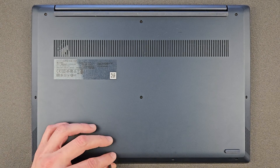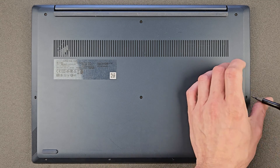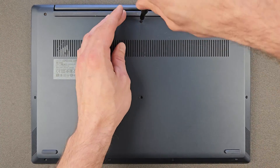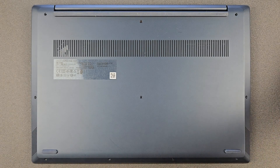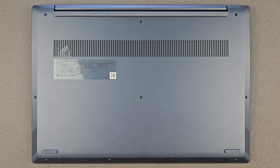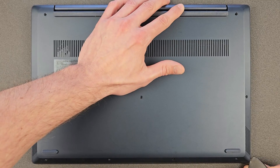I'm just showing you the screws here — they're all the same size, so you don't have to keep them separate from each other. Sometimes they are a different length so you have to remember where you took them out, but not this time. Go ahead and remove all of them and you're ready to lift the back panel. The back panel comes off easy enough. I have a plastic tool for that — it's super easy with that. If you don't have one, use a credit card or something similar.